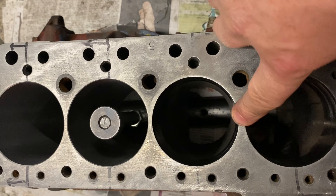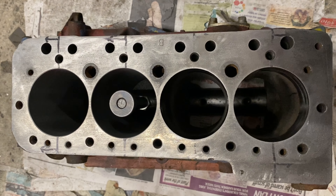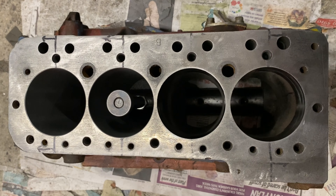We're going to end up with about 127-128 thou there when bored, and this one is going to be about 134 - so they're pretty even. I've maximized the space - there's a good 10 thou more across the middle than before - but I can't go any more because the spacing won't match the gasket. These two cylinders will get bored straight down where they are, whereas these two have been offset in that direction.